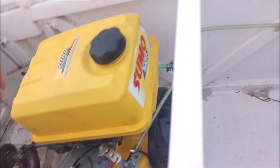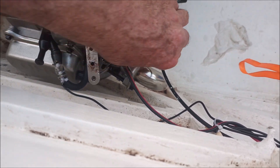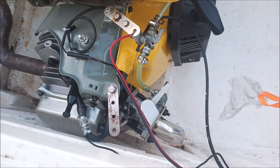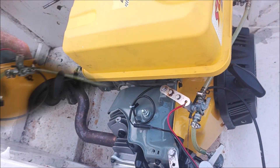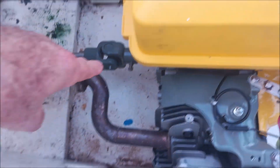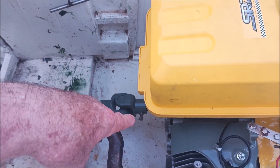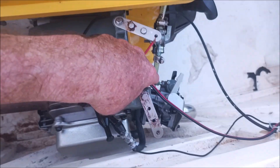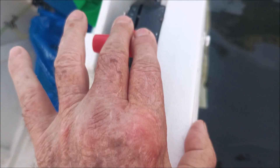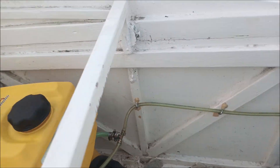I still need to fine-tune this. I've got to figure out where the throttle is — I may have to loosen this clamp and pull it tighter, do some kind of wiggle adjustment to get it all fine-tuned so that when I pull it, it starts the first time under load. I'm going to disconnect the cross joint so we're not under load, and tomorrow I'll fiddle with the throttle cable adjustment so it's set at a position where all the way back it'll start, and forward is just go faster.